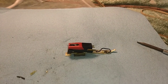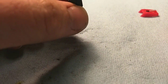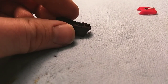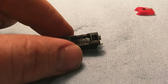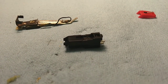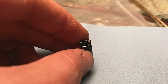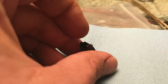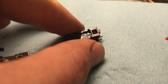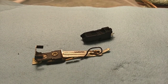I'm going to reinforce this with some epoxy and then show you what I do to wire it up. Before I epoxy this, just as a note: you're going to have limited spots of attachment. The two little nubs up here you'll rough up a little bit and epoxy. But really the main point of attachment is going to be in that little crevice there — that's going to fit over the metal piece I trimmed down. Use a nice strong 5-minute epoxy; you might even want to use JB Weld. Don't get any epoxy inside the hole where the clip for the stylus goes, or it'll gum up your reeds and this won't work. Be sparing at the front with the epoxy and very generous at the back in the little crevice. Pay attention to that, otherwise you'll end up having to do this all over again.